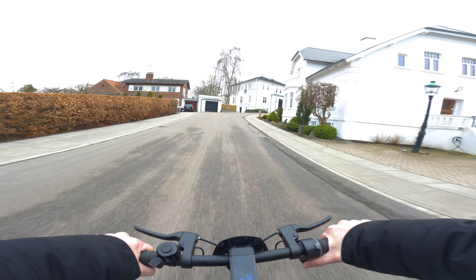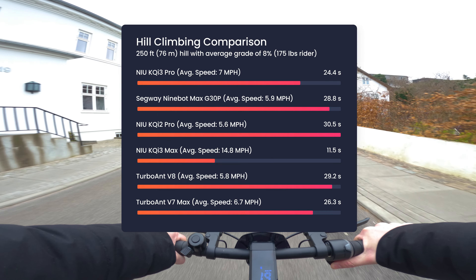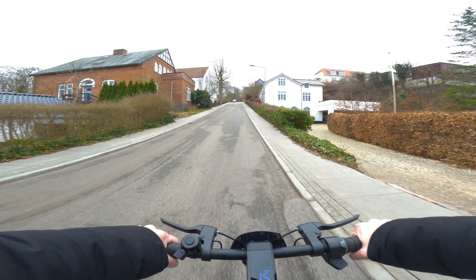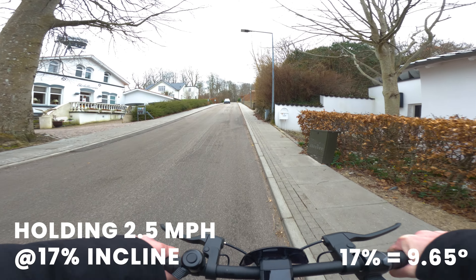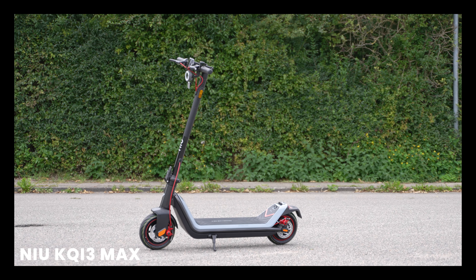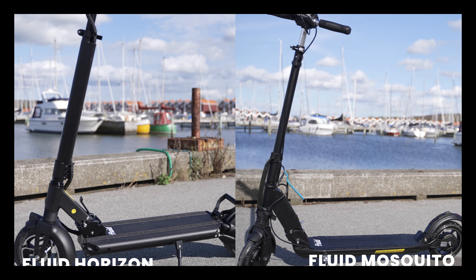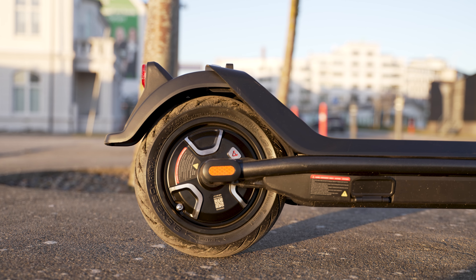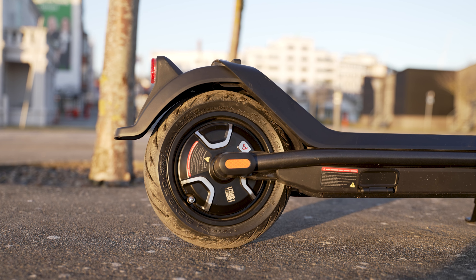So how does the KQi3 Pro handle hills? I tested it on a 250ft incline with an average grade of 8% and completed the climb in 24.4 seconds, which is much better than the KQi2 Pro and Segway G30P. I also tested it on the steepest hill in my city, which peaks at 17%, and the KQi3 Pro just barely made it to the top — I'd say 17% is indeed the max climbing angle. The KQi3 Max is much better on hills, so it may be a better pick if you have steep hills on your commute. Alternately, you can consider the Fluid Horizon or Mosquito, but they aren't as well designed in my opinion. All in all, solid motor performance. The KQi3 Pro benefits from its 48V setup and is one of the superior commuting options in its class. For most riders who don't have to battle steep hills, it's more than enough and the performance retention is just great.